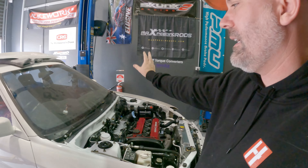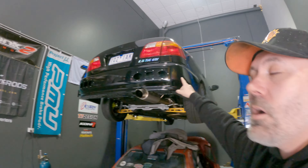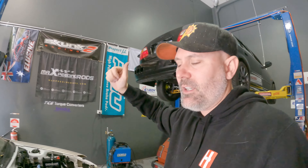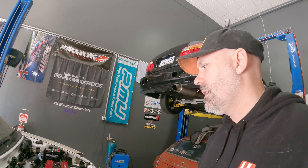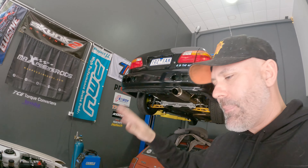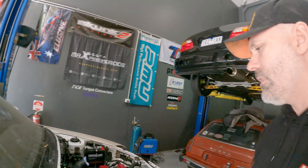The Haltech wiring loom is all in and clicked in. I've got to borrow the Haltech from my Civic and put it in the Evo to get it started. While the Evo is running and I'm enjoying it, I'll also be working on the next project with the Civic. The beauty of a Haltech is you can share ECUs between cars — it's a little annoying because you've got to upload your map every time you switch, but it's literally two plugs and a vacuum line. It saves you buying another couple of thousand dollar computer. Save your map, upload it, off you go.